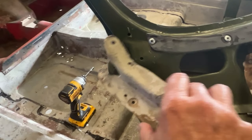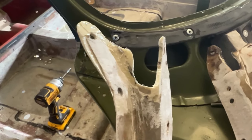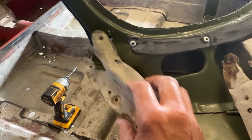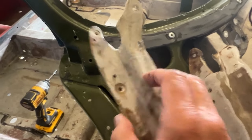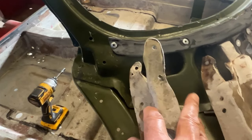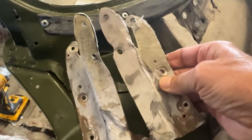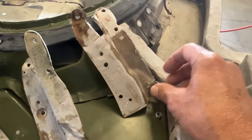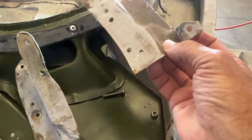I repaired that spot in the floor and the corners. I split that to make it fit better up in this side here, and you see I reinforced that. I patched another little hole that was here - I actually taped it on top because the chop was missing out of the bottom. This piece, if you look real close, was missing quite a bit of it. What I did was I put some foil back tape here, bolted this on, and then put a bunch of fiberglass in there with resin. Then I shaped it to look like the one on the other side. I also had a little repair here - I'm going to put a little bit of reinforcement where it was cracked. This little tongue here was cracked, so I'm going to reinforce that from the bottom side.